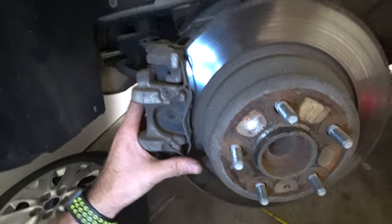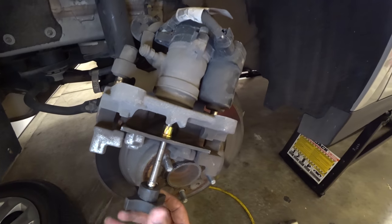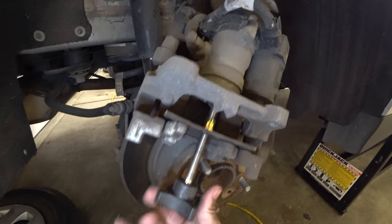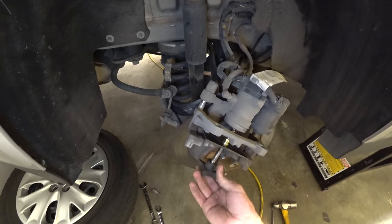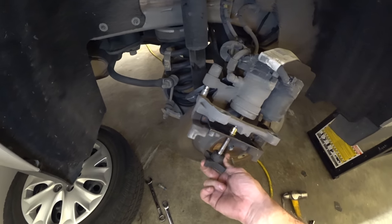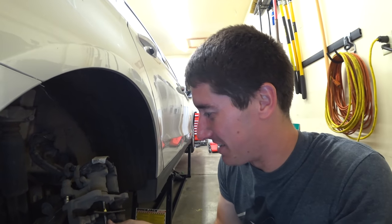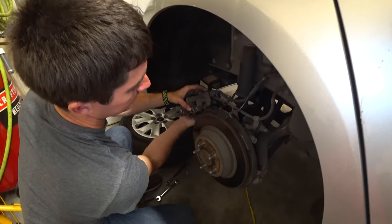While Cash is getting that rear driver wheel mounted, I went ahead and got this off, so we are ready to swap the last of the brake pads. We'll just open this up, change those pads real fast, and stick it right back on. We don't want to overfill the brake fluid, but we'll just run this down until it's all the way back in. I'm just checking the brake fluid reservoir every few seconds. Is it overflowing? No it's not. The brake fluid's still good. If you can barely see the fluid level, you are really low on brake fluid — which from an install standpoint is good. A couple seconds later this one's going back together and I think we're done.